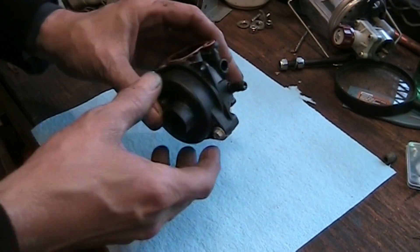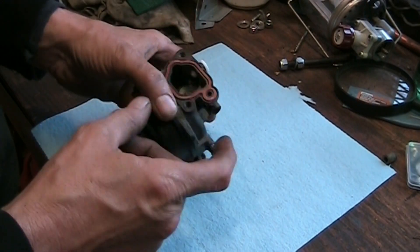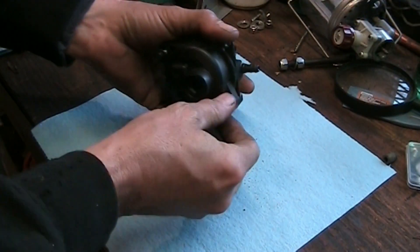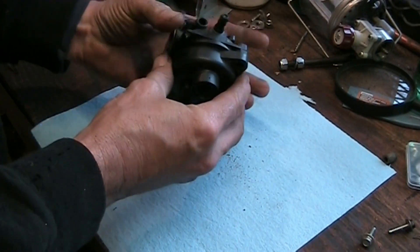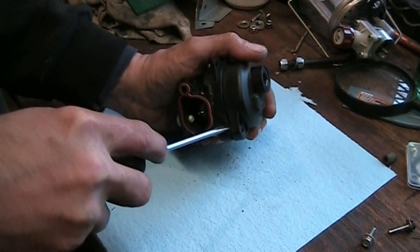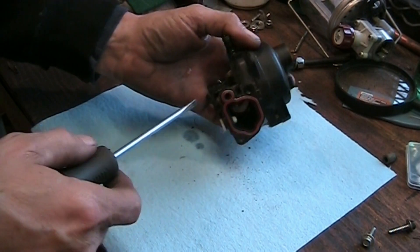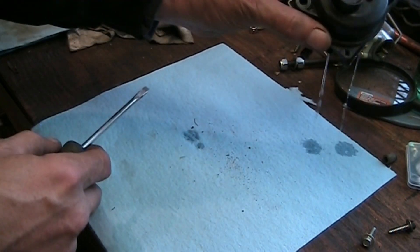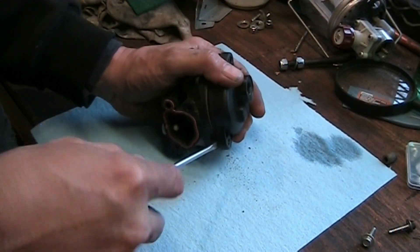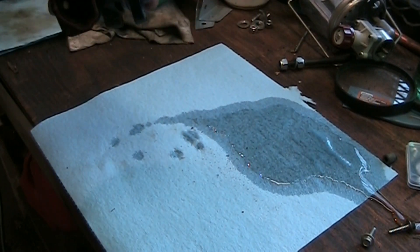I'm not going to go with my normal bird's eye view. That's where that little plastic piece for the vent was. Just pop that bowl off - 7mm. These bowls are actually quite sticky. Let's find a place to gently pry it out. As I'm cracking this loose there's water coming out of the vent - that is just water, there's no gas. The bowl was full of water.